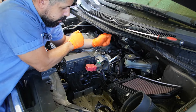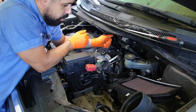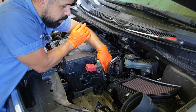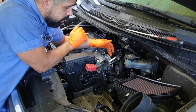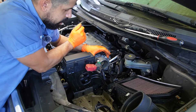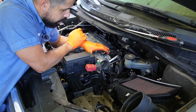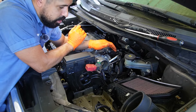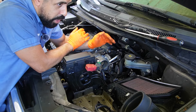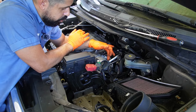Whenever you're doing a job like this, you're going to want to disconnect as little as possible and only disconnect the things that you need to. I have to remove the intake manifold, but the throttle body is attached to the coolant lines. So I'm going to remove the throttle body and leave the coolant lines intact because I don't want to get coolant everywhere — it's going to be an easier, better route for replacing the valve cover gasket.